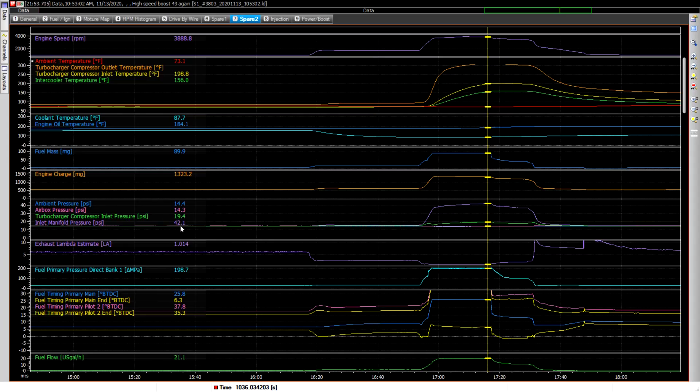Boost got to about 42.1 psi - so I'm back to getting that extra three pounds of boost I had before. The good thing is the exhaust lambda: 1.02, 1.03, it never got below 1.0, which is perfect. That means it's dialed in really nicely - I'm not running rich at all, just running cleanly. The injector timing is starting at 25 degrees before top dead centre and finishing at 7 degrees, and the engine seems to like that. Ignition probably starts somewhere close to top dead centre.